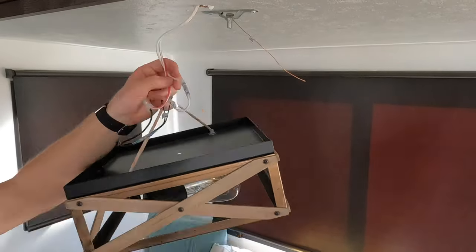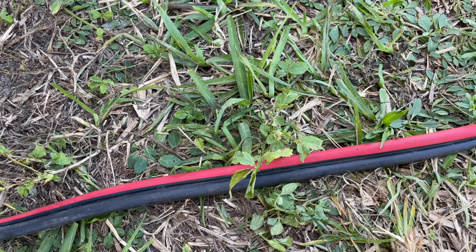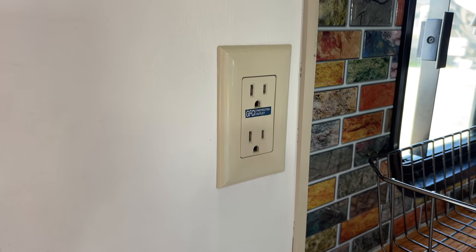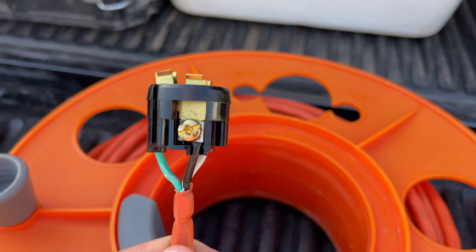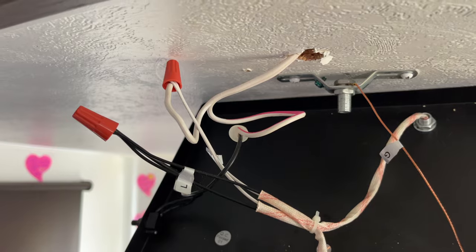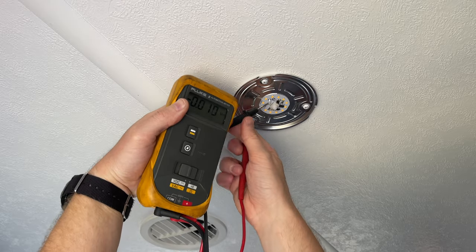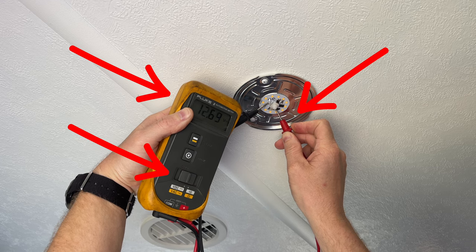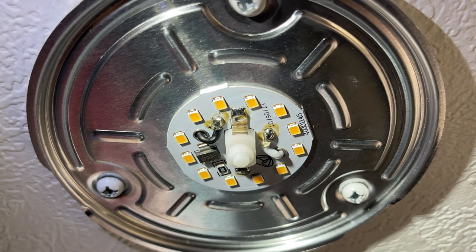The positive, negative, hot, neutral, and ground wire colors get a bit convoluted because not all 12 volt RV lights are wired with the same color wires. Most 12 volt systems standardize on red for positive and black for negative, while most 120 volt home systems have a black hot wire, a white neutral wire, and a bare copper or green ground wire. But sometimes RV manufacturers use other colors, as with the white and white-with-color-stripe on the 12 volt system in my rig. The easy way to verify the positive side is to locate the wire that has the switch installed on it. You can also grab a multimeter set to DC — when you touch the leads to each wire and the multimeter shows positive 12 volts, the wire the red lead is touching is the positive wire. Sometimes, if you look closely at the old fixture, it may even show positive and negative symbols at the point of connection.